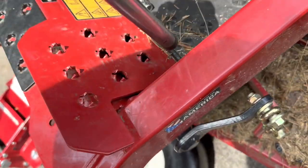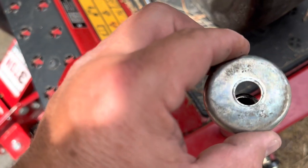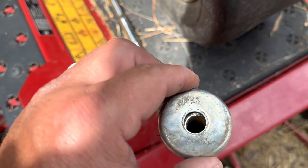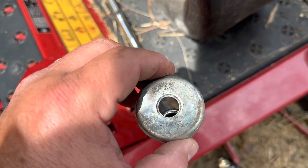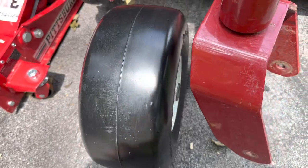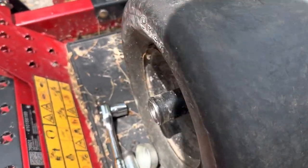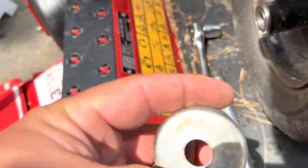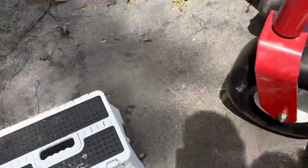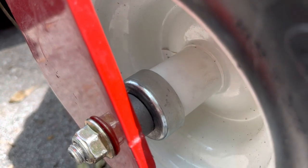These holes here — the way this fits, it will not go through there. With the new hub, it's not as wide by just about an inch or so compared to the stock hub. So you're going to need to drill these out so they go over this area here, because you want them to go over where your bearing sits.